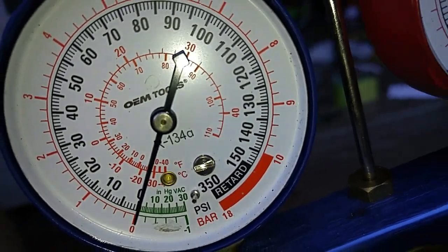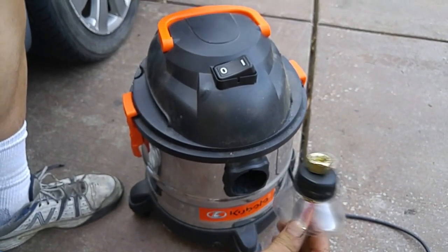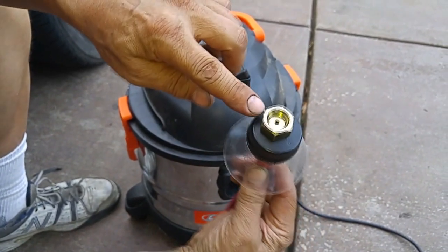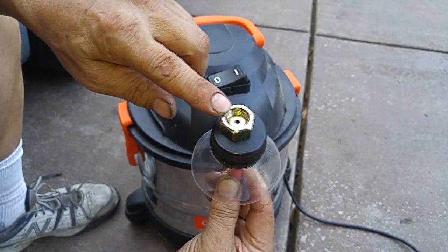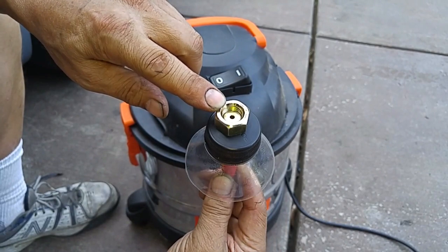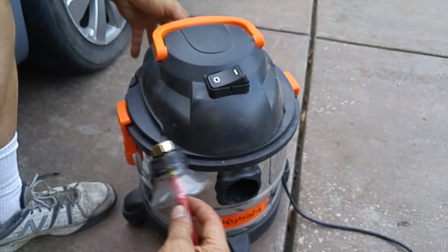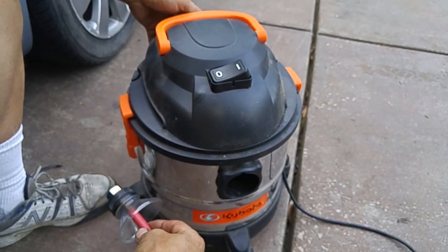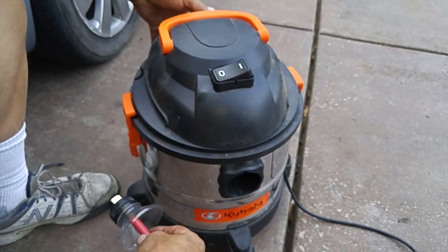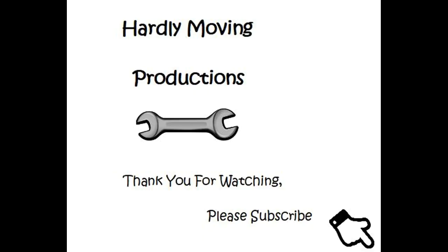It does pull vacuum. The question is, will it create enough suction to actually do a brake bleed? It's an interesting idea, but using a shop vac instead of my AC pump in the end turned out to be disappointing. It just didn't pull the vacuum needed to perform a brake bleeding service, and I really doubt it would be a viable replacement for my AC pump. Later on, I'll be using my AC pump for doing transmission and engine oil changes.